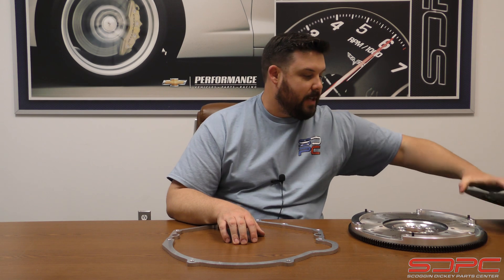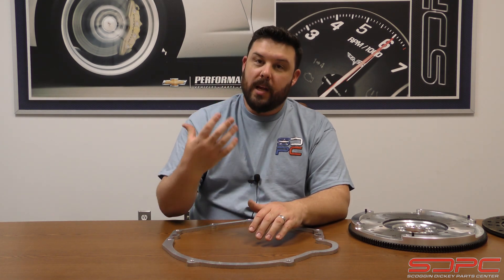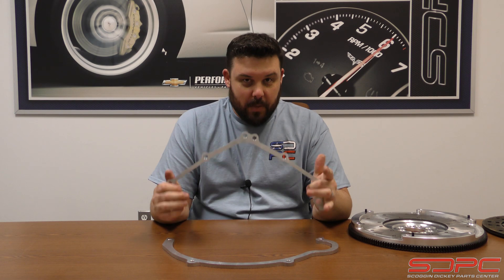You need to know that aftermarket clutches — twin-disc, single-disc, or even something as simple as an OEM LS7 or LS6 clutch — can all be used, but they all have different stack height measurements. This is something you are supposed to check when installing a clutch. A lot of times the KTEC spacer we use for the CTSVs can be used in those applications — they are about the same thickness — but you have to measure and see if that same thickness will work. If not, there are other spacers and adapters we can offer. Once you take that measurement — and you do have to take that measurement first, we can't go by application — call us and we can get you hooked up with a real high-quality ICT Billet piece and the right spacer to make sure everything lines up so you can roll gears behind your new favorite Gen 5 LT.